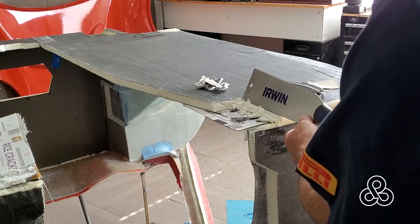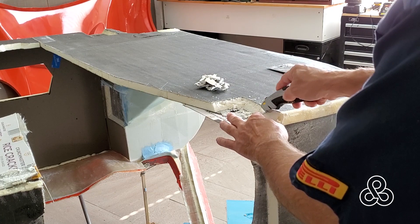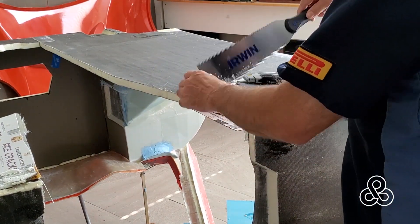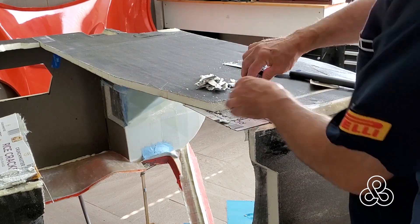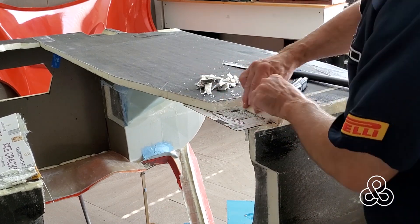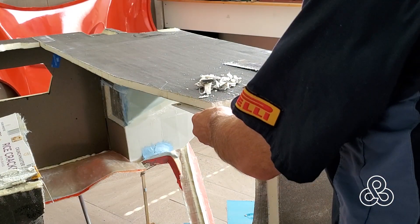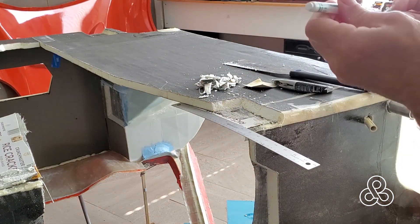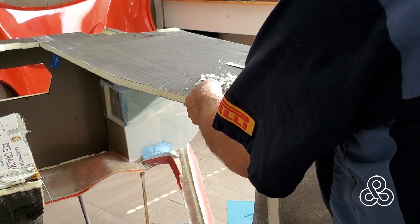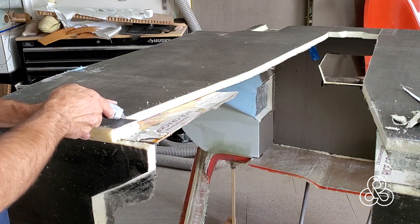Let's go take a look at that. While we were trial fitting our subframe, we found that the transmission mounts that are part of the bell housing I've created kind of interfered with the foam, the bottom sheet of this tub. So I trimmed those out, and just to get the position set, I laid a piece of cardboard across those little tabs or the transmission mounts, and then laminated that piece of cardboard in place. That's what you're looking at here — that piece of cardboard which is going to form a surface for us to build the tub up here as a reinforcement for those mounts.